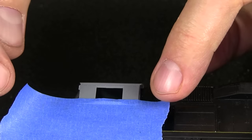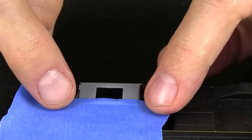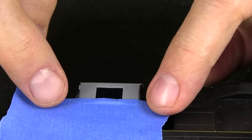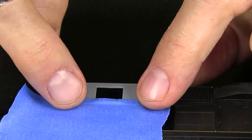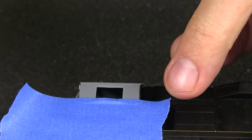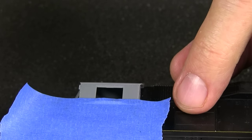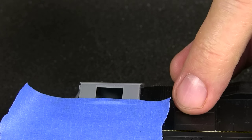The handrail I just made on this side and the one I'll need to make for this end both mount on the cab at the same level. So I put a piece of blue tape on here so I can drill the holes at exactly the same level — that's my straight edge. Because if they're mismatched, it looks really bad, and I really don't want to have to fill it in and start over.